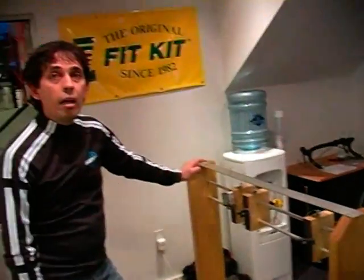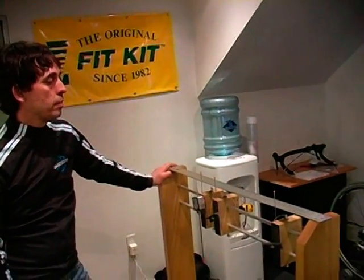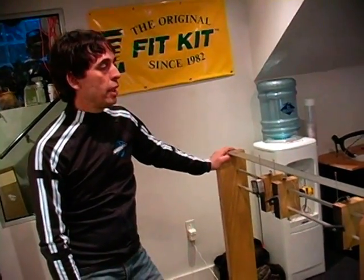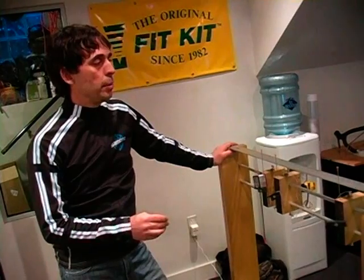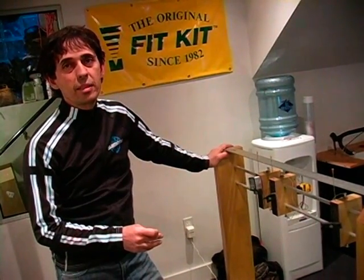You can take this bike that you've already fit somebody on, transfer all the measurements through the laser jig to numbers on paper and the computer, that you can then use to build his real bike. Correct. So not only does this provide us a base study for bike build, but also it becomes a permanent record of this dynamic fit, otherwise that would be guesswork.